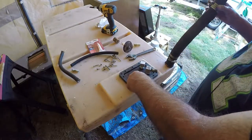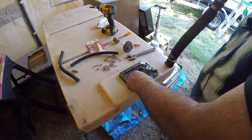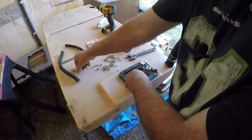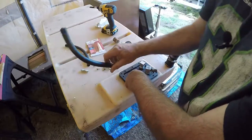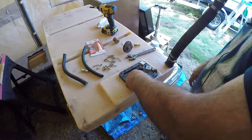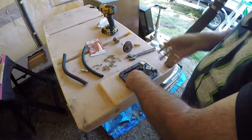The actual fuel fill tube is still in good shape, so we're going to leave that. The vapor hose was still good. As for the fuel hose, it had basically welded itself in there and I had to cut it to get it off — plus the hose was getting pretty bad. So I got a brand new hose; you won't have to worry about leaks.